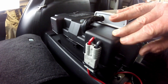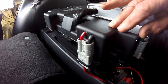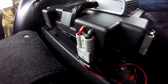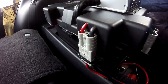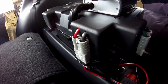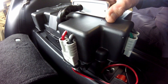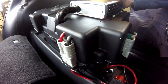One of the things you could do with this is if the starter battery in the front of the car was run down, you could unplug the connector and push it into the front output connector of the battery box, give it about 10 minutes, and that should give you that little bit of extra charge to start the motor. The battery I've chosen for in here is an absorbed glass mat battery and they don't go well with trying to crank a motor — that's not what they're meant to do. They're meant to do things like run this fridge, however it will charge another battery to a certain extent if you connect them together.